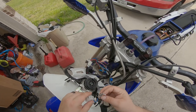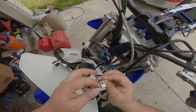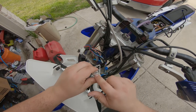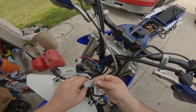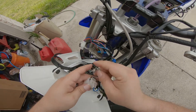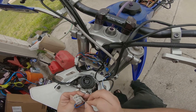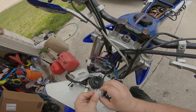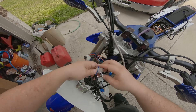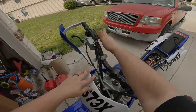Earlier I was saying it wasn't important to fix the high and low beam swap, but these are actually fairly easy to take apart. You see this little clip right here — you reach into this area with a small flat blade screwdriver and bend it back, pull the connector out, bend the tab back out so you have a bit of snap and catch to it, then feed it back into the light connector.